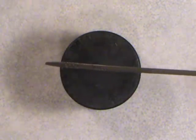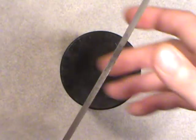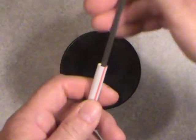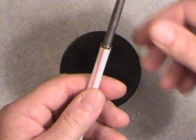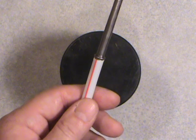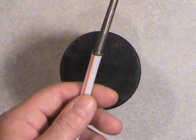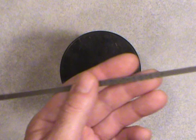Okay, then what you have to do then, you know it's clean at this point, there's no false reading going to be there. You just get it and you put it back in the engine, right? Put it back in the engine until it hits its stop. Okay, and then it's basically count to three seconds to give the chance for the oil to stick to the dipstick. Don't rush it. Just count 1, 2, 3 and you're ready. And you withdraw it again from the engine. And then you turn the dipstick horizontal, okay?